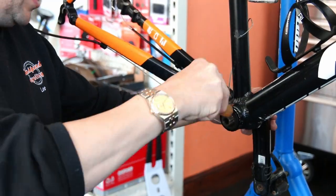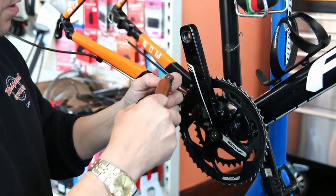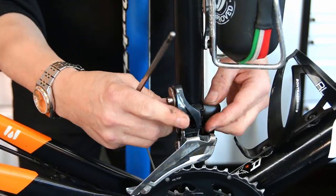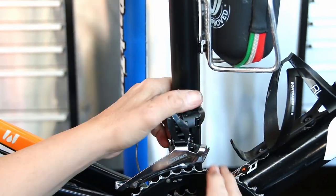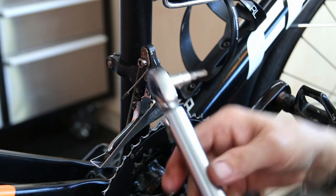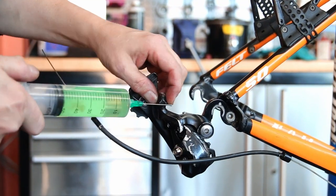The biggest positive is the way things stay clean, but the biggest negative in my opinion is using it through the winter — it didn't really stay waterproof. It lubricated the chain perfectly but you do get a problem with the chain maybe rusting, so you'll need to be drying off your chain at the end of each ride or getting it re-waxed quite regularly. If you leave a chain wet on the bike it will stiffen and it will really need re-waxing at that point.